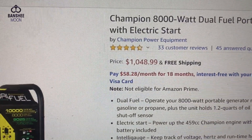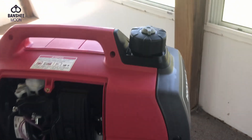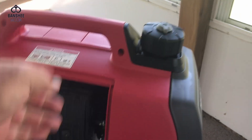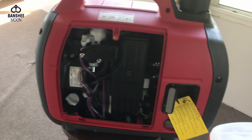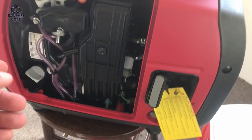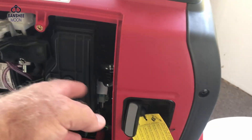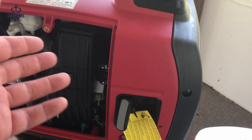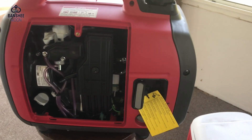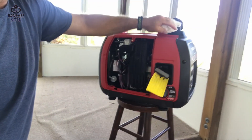It actually turns out to be about the same price as the EU 2200. So just to be on the safe side, when you're dumping the last bit of your gas, you want to tilt the unit that way — even though you've taken your oil out — tilt it so you're not tipping it toward your carburetor. You don't want any residual oil flowing back into those lines, into places where it doesn't belong. Then to finish up, I'm going to replace the oil with no gas in it, and once the oil is replaced I'm going to crank it back up to burn out any residual gas in the fuel line and fuel pump.